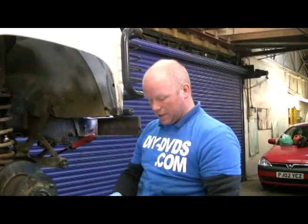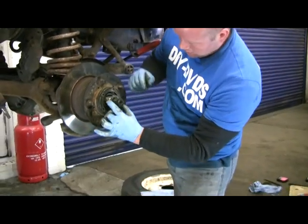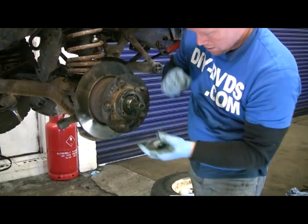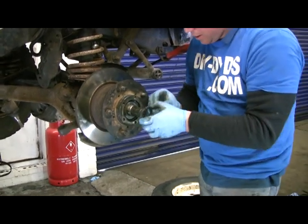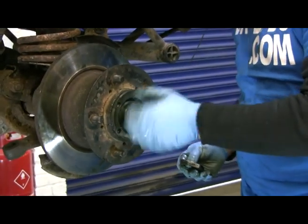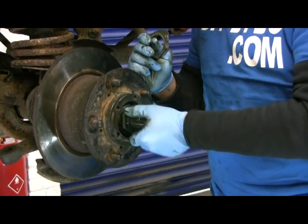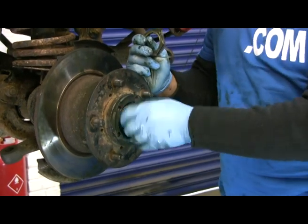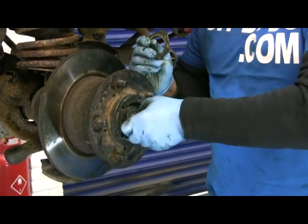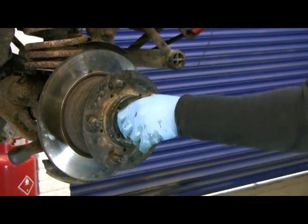Okay, the reverse order is your collar with the little pin, so slides in there over the groove, whack that up, then you put a nut on, wind the nut up, buy the box spanner if you need to, it's only about a 5 or a 10, brilliant tool. Don't use hammer and chisel on them hub nuts, it is bad news. Sooner or later you'll be changing them.